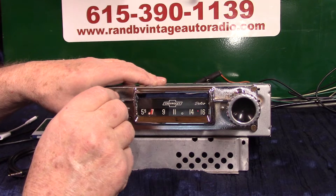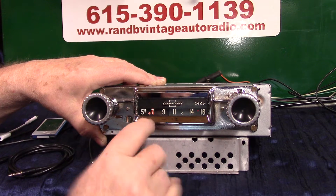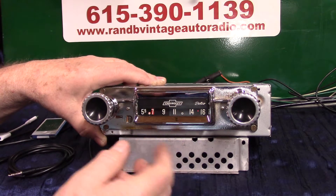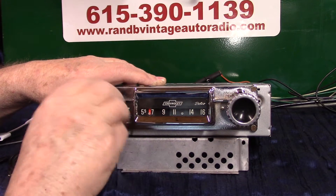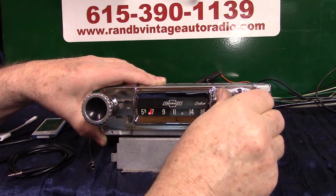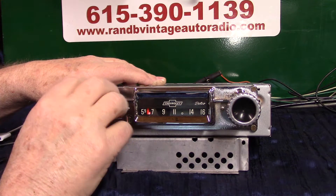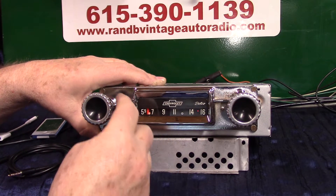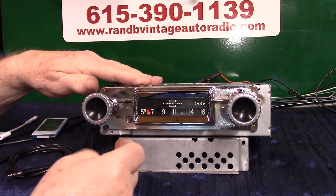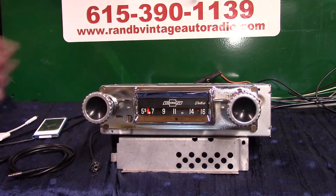Right now you're on FM. Right here you've got a little operating LED, and over here you've got a stereo LED. They change color depending on what the radio's doing. If you want to go to AM radio, just simply turn the radio off and right back on — takes you to AM radio. Turn it off and right back on, takes you right back to FM stereo. Got your usual bass and treble. And if you hook up two speakers, you'll have balance built into your tone control. If you hook up three or more, you'll have balance and fader.